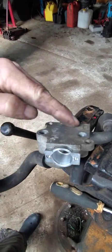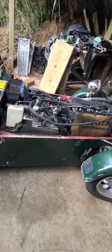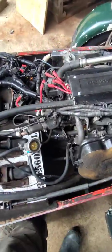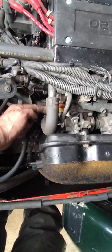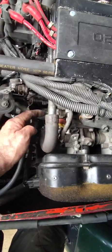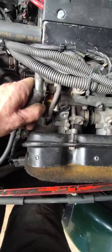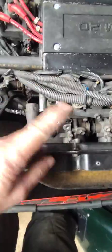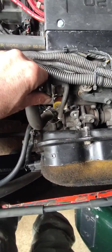The spring is becoming hot from the heat transfer of the cylinder head onto this device. Let's go to the car and watch what happens. I've taken the hose clamp off the intake manifold where the device feeds. When I pull this off — OK, now it's pumping. If I block it off and set the idle with my finger, that's exactly the same as the device being hot or cold and limiting the air.